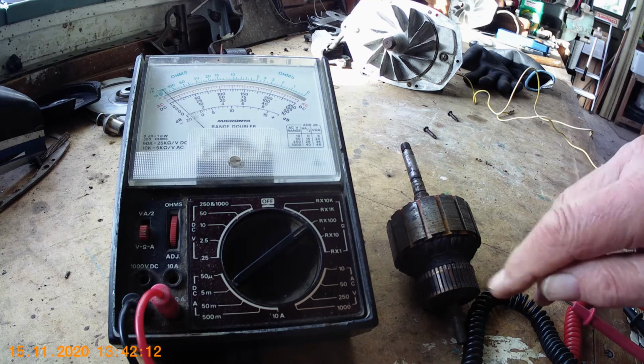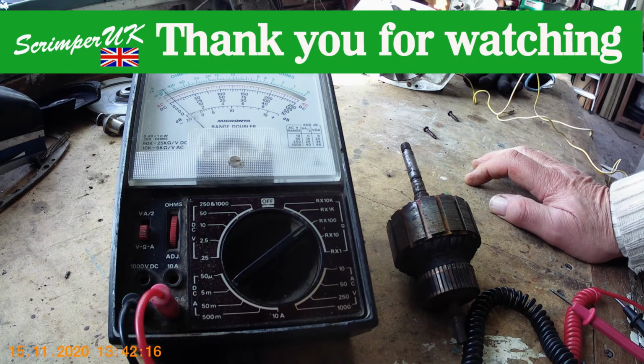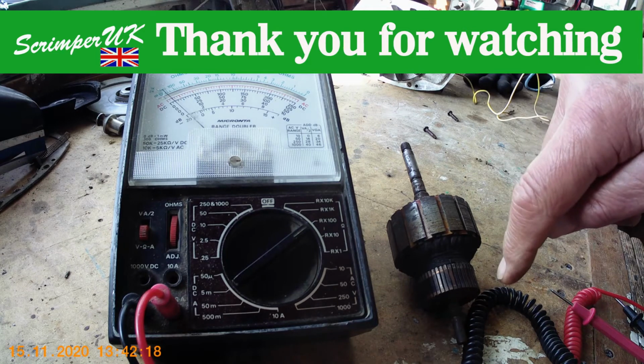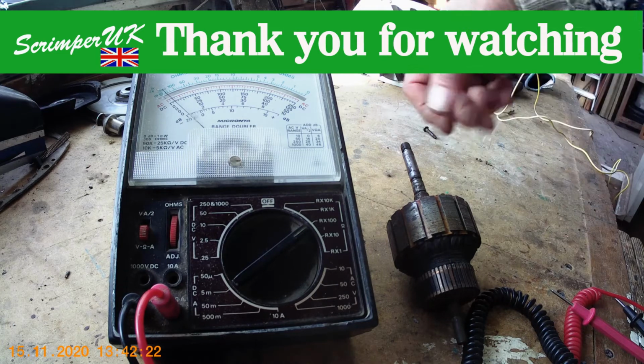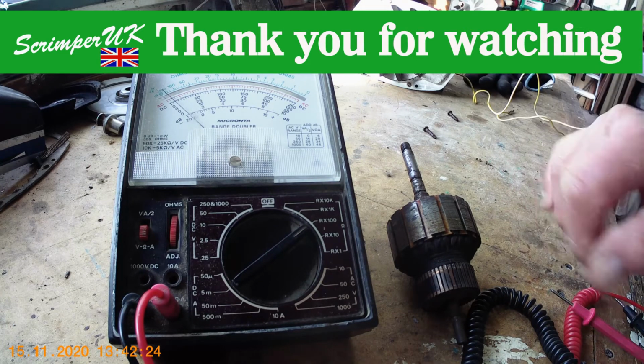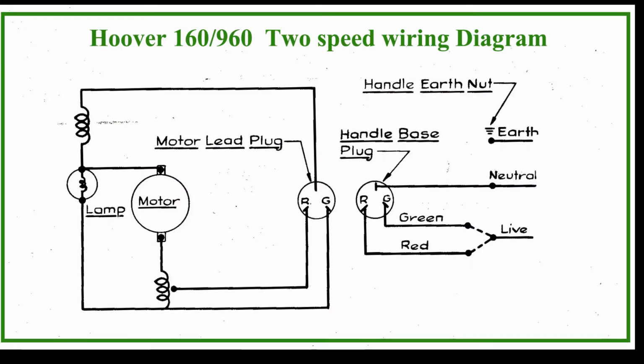Occasionally you can get one segment that doesn't work and the thing will still turn round, as long as it doesn't stop on that segment. Once it's going, it will actually keep going. Sometimes, not always, and if you give it a twirl, away it'll go. And that could be just one of the segments causing problems on the commutator.